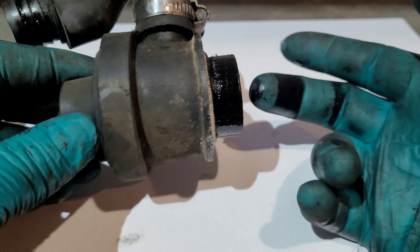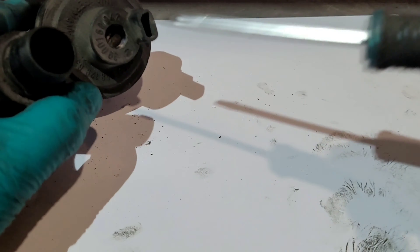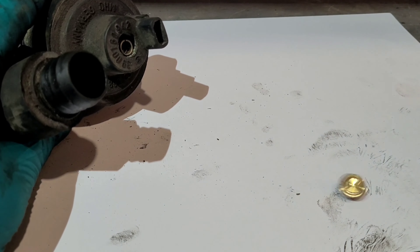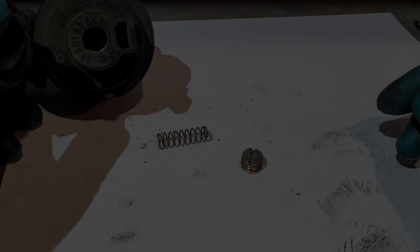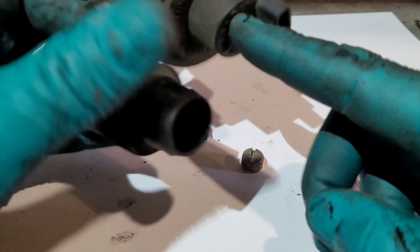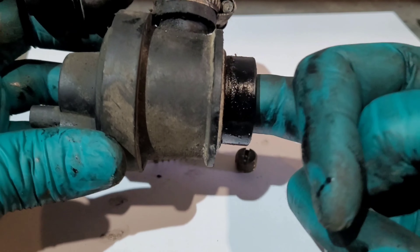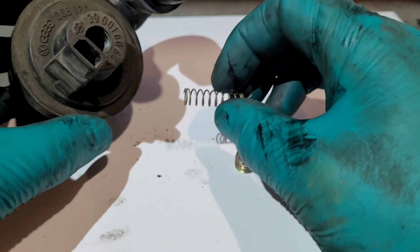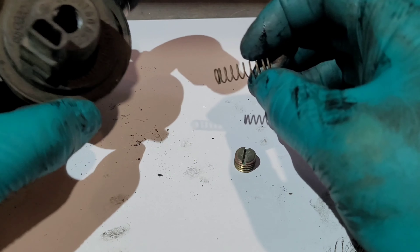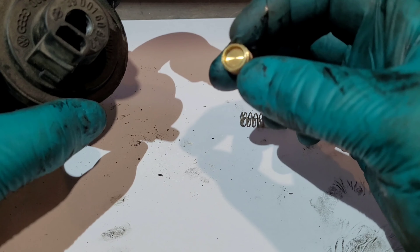What we need to do is take out this screw. Not much to it — a screw cap, a spring, and a hole. We need to put something in this hole to block it, because if you screw that screw tight it still allows the diaphragm to move. So we need something about the same thickness as that spring and enough so we can screw in, compress the spring, and hold the diaphragm tight.